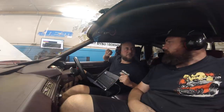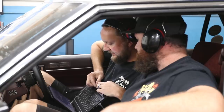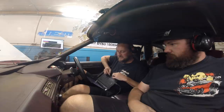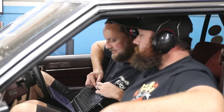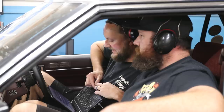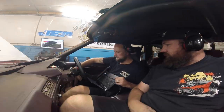It's kind of the point now where we need to go straight forward, do that and see what happens. Then I'm going to go back to 38, the one in between, and see where we're at. Our mixtures are at 11.0s if anyone's interested. I know that's overly safe for what we're doing, but it keeps it a little bit cooler, things are nice, and it's pulling out 3% and 4% everywhere up the top. We're at 90% injector duty up there.